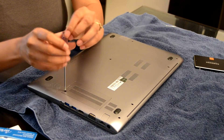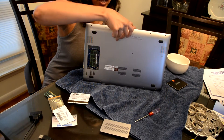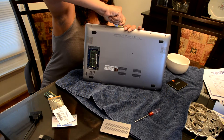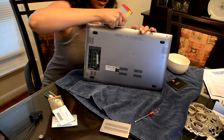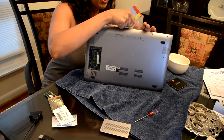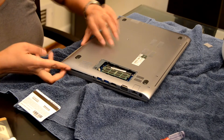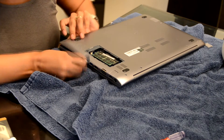Now I'm going to open up the back of the laptop. You just want to use your fingernail and get as close in as you can into the crack, and then I'm going to jam this card in and then gently push up. You'll hear a click of the plastic tabs opening up, and I'm going to do that all the way around. I've gotten almost all of it open just by using the fingernail.